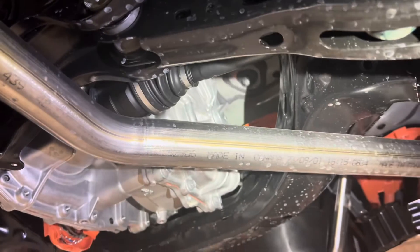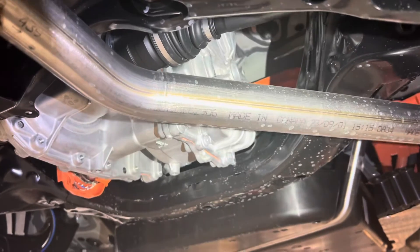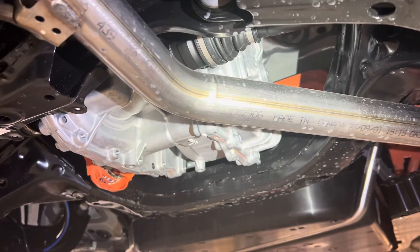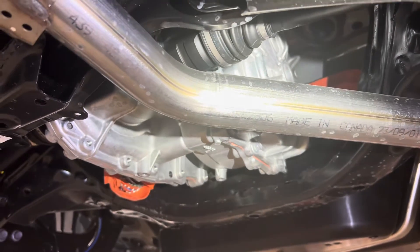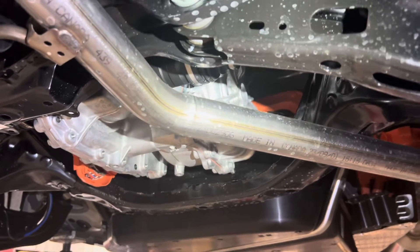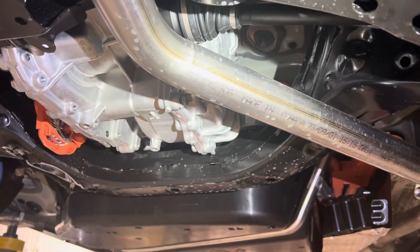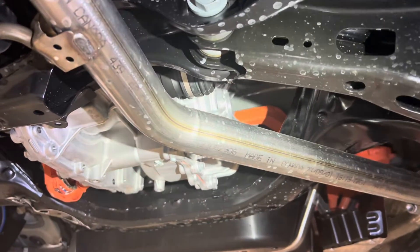It's simple, and it means you have fewer moving parts — fewer mechanical things that can go wrong with this car by a long shot. No drive shaft, no center differential, the rear differential is simpler. You don't have the U-joints, you don't have the disconnecting rear differential or drive shaft. All those things make for a much simpler all-wheel drive system.